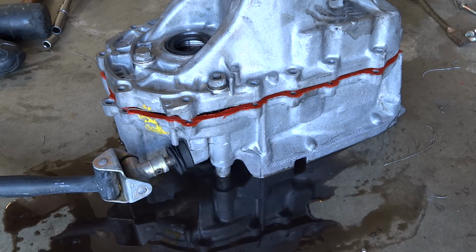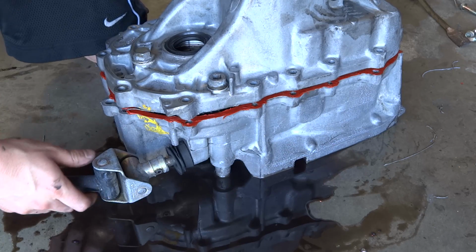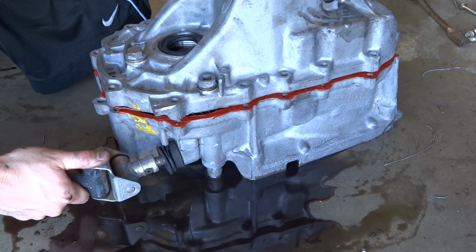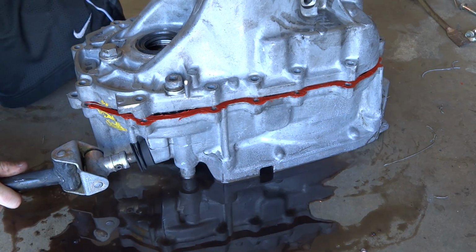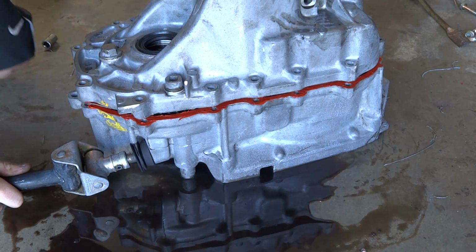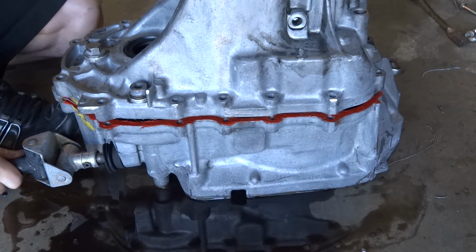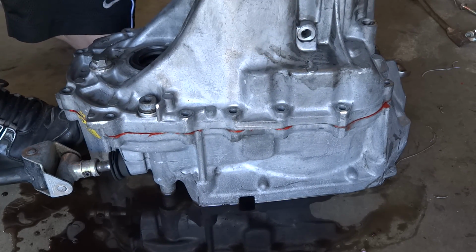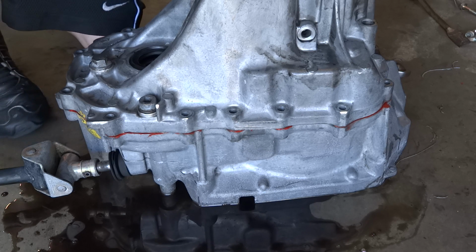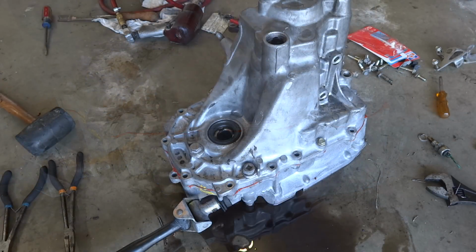So you push down your tranny and it only goes this far, it's got a gap. Well, now you have to take the linkage and kind of pull out, move it in a second, and it should immediately drop down. There we go. Now we're on the snap ring. Now we have to open the snap ring, and the transmission should go all the way down to the bottom.